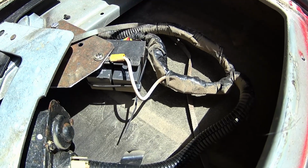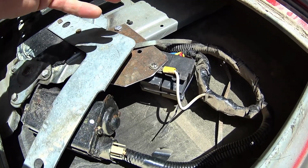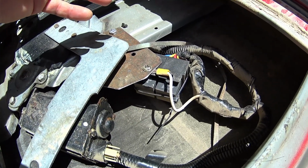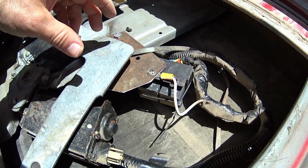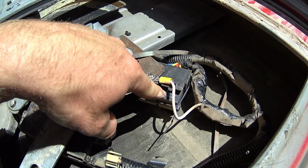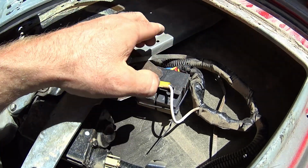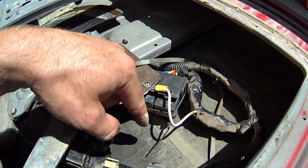Here's a shot of the inner workings. I put this in about 2 years ago, and we instantly made a trip across country. During that trip, the motor failed on me twice. What it ended up happening was through the vibration, these relays would work their way out, because I originally had them kind of turned downward, and the relays themselves would walk out of their actual coupler.